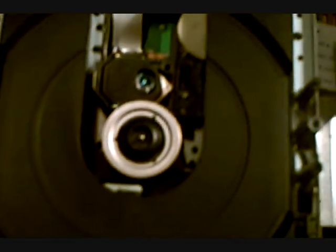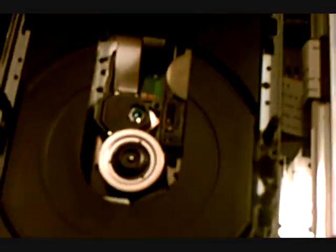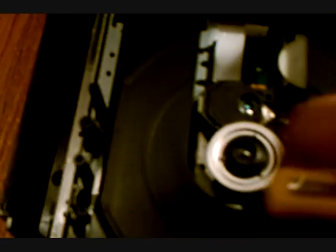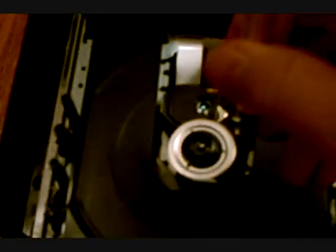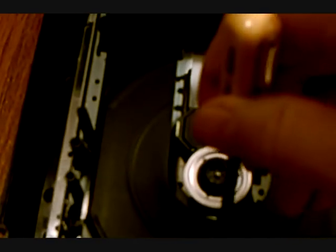So pretty much there were two screws connecting this piece, and that's what holds the disc in place so it's not wobbling around when you're playing — and it's magnetic. When you look in and take the game out, you can see the lens and then the CD spindle right here. There's a little wheel — it's kind of hard to see, but if you look right there, you can see the little teeth on that wheel. If you spin that, it will first lower the CD spindle down in, and then it will eject the disc tray.